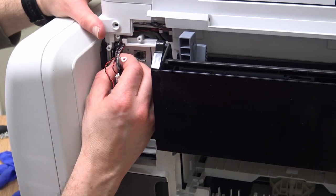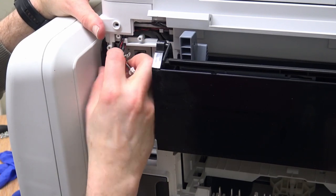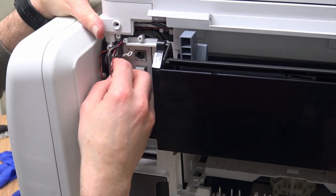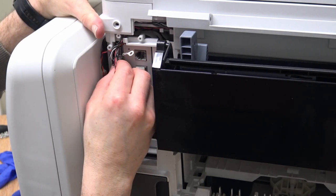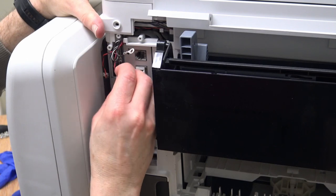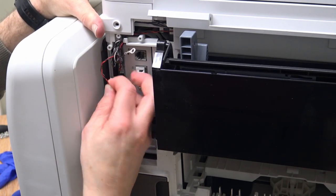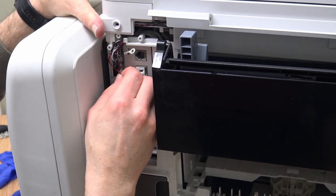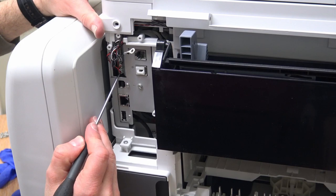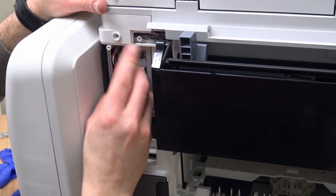Start with the top one which is the biggest one. Just take your time with these - don't force them. You can quite easily put a three-pin and a two-pin connector in the wrong place if you force it a little bit. Good eyes do help - you could use a flat blade or tweezers to help you get these in. Pop that in with a flat blade properly, and just make sure all the others are in. There we are.